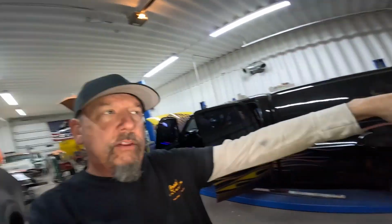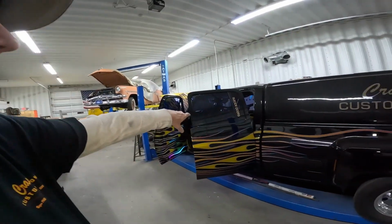The first go around with the lights, that was during the day. In the afternoon, the side of the building that it's on is shaded, but the sun was out, plus all the shop lights. The other time, obviously, was at night with the shop lights on, but the outside parking lot lights were off. I'm really happy with the light bar. It's doing everything I wanted it to do. Brighter brake lights, directionals, and I have reverse lights now that are wicked bright. Once I figured out the flasher, the LED flasher needed to be installed as opposed to the stock non-LED flasher in an old school. Square bodies are old school now.